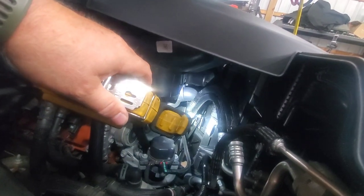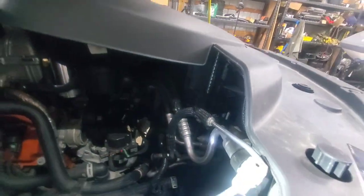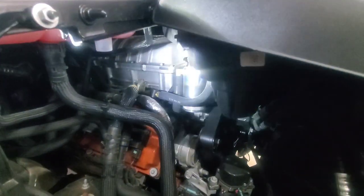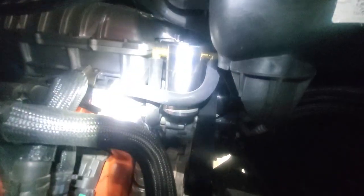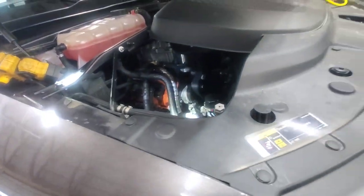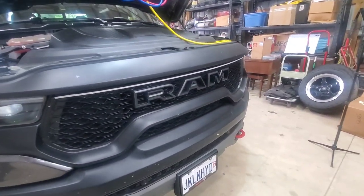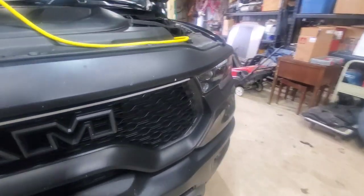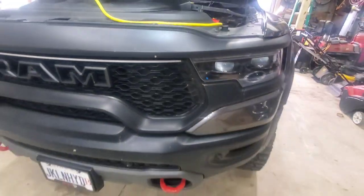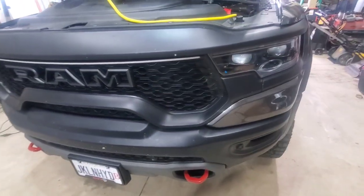Right past the water pump there's a coolant hose over there. You'll see it better when everything's hooked up — you'll see the yellow hose into it. That was the reason I put the catch can here, because it's out of the way. The tank is gonna get mounted right in this big open space. We've got to get all this front grill off so we can mount. First thing: this inner chiller gets mounted, then we tap into the coolant hoses.